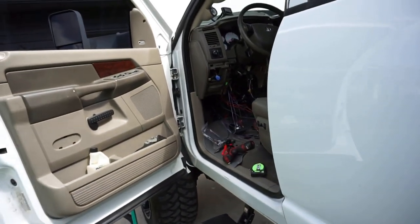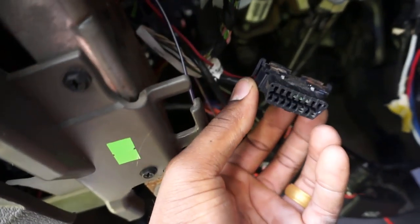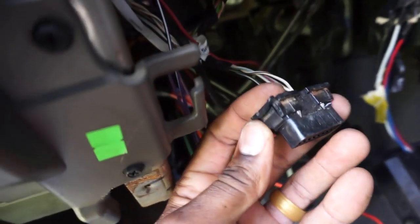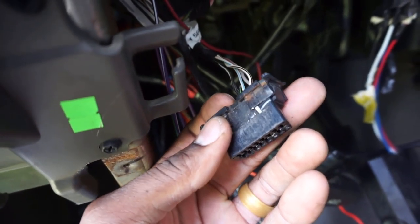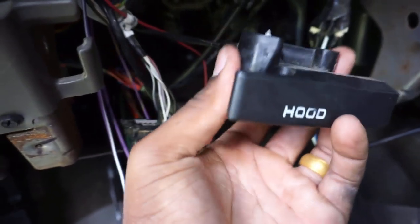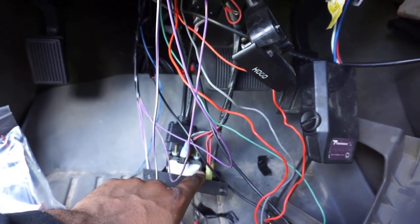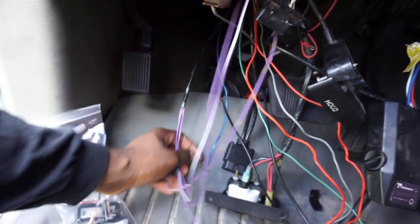Once you take that off, it just comes off, and then your OBD2 connector snaps in with these little tangs right here on the side. So you just snap them out, push it back. Hood latch, 2 screws, it sits like this. You just undo them, and then it's free. Don't worry about the brake controller. This is my trailer brake controller. That's optional. Same thing with my air gauge for the airbags in the back. Okay, so back to business.